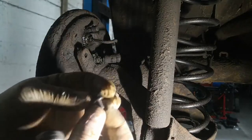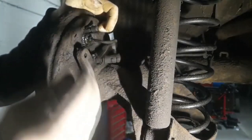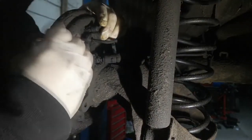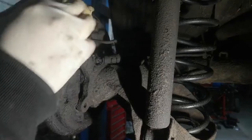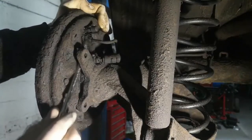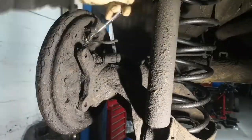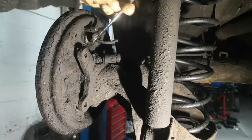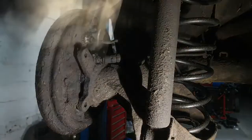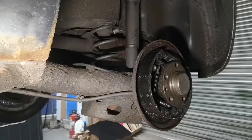That's how big it is — only about 10mm thread. So that's out. Now I can work on the brake line. It's an 11mm spanner. I've got to work it back and forth so it doesn't snap the brake line. Could you see how it was twisting it then? Ever so slightly. This one's actually one of the better ones — it freed off straight away. I don't know if that was down to putting WD-40 on it earlier. Right, that should come out now. Back at the front now.